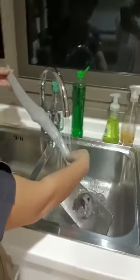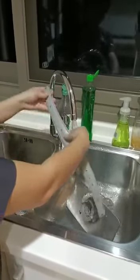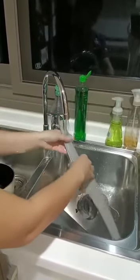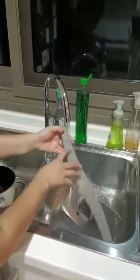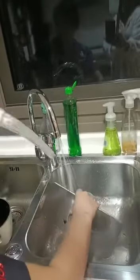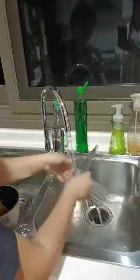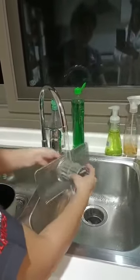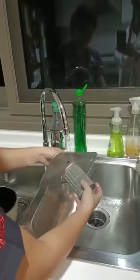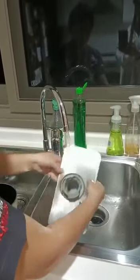Don't wash it. Sometimes this hose is blocked with grease if the dishwasher is not cleaning properly. And also, we can use a toothpick in cleaning these holes. And the filter, we can use a soft brush or we can use a powder or soap and then brush it slightly.